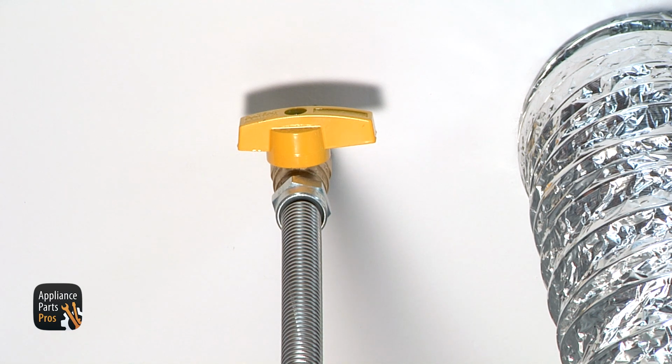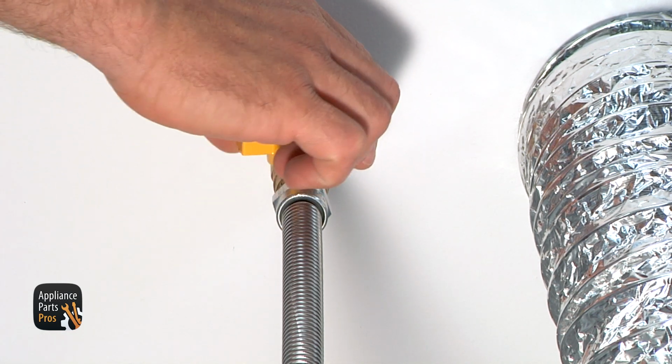After it gets really hot, the gas valve opens, gas ignites, and the igniter shuts off. If there is no flame, the igniter and the flame sensor cool down and the cycle repeats. That is the sign of bad control coils or a sticking valve. In both cases, the gas valve needs to be replaced. Oh, and just in case, check if the gas shutoff valve behind the dryer is open.